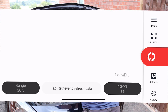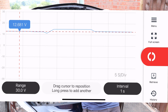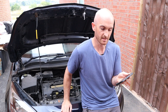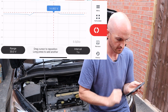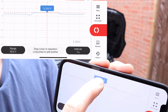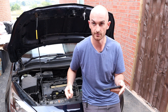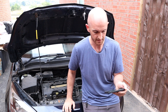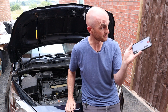When you want to finish your logging you just hit the red tab again and you can see the line on the graph. You can long press to add a cursor on the screen where you want to measure — we can see 12.68 volts there and then where it goes up we've got 14.84. If you hold on the tabs you can drag the cursors around. That could be useful for battery drains, maybe if you set it up with a current shunt rather than doing inline current. Two amps isn't very much and you'll probably blow the fuse if you were to turn the ignition on or wake the car up. Let me know in the comments what you think you could use this logger function for.